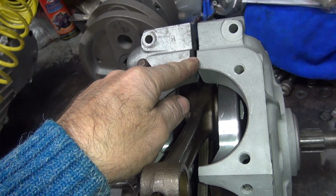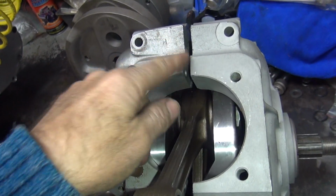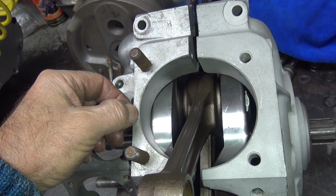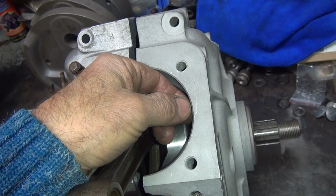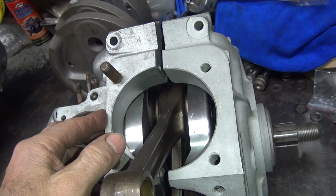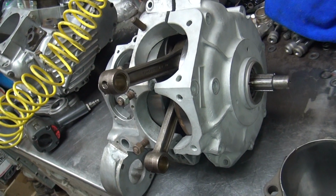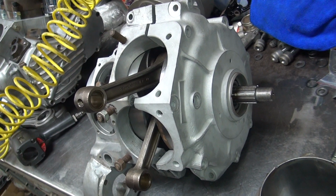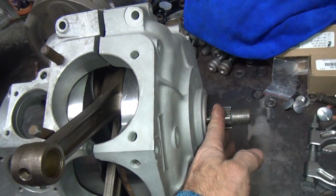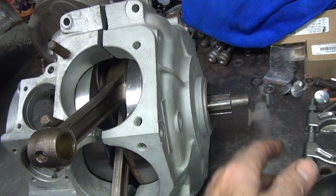So I'm still going to want to have at least something in here pretty thick. If I put a 1/4 inch in here, that'll give me about 25 cut off of each one of these 2 pieces, which would be about this much. Basically cut about half of this chamfer out, which would be probably pretty good. And 1/4 inch material is easy to come by, so it wouldn't be hard to come up with a piece of 1/4 inch. Probably got some of that stuff laying around someplace. So that's what I'm looking at doing. And we'll just make up the difference on the shaft over here with the sprocket to run to the back. So I'll probably want to run some kind of a belt drive, even though I don't like them because of oil.